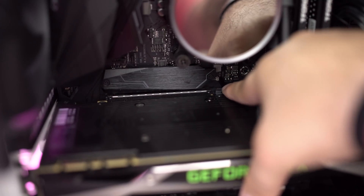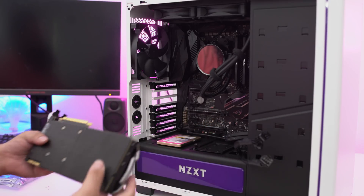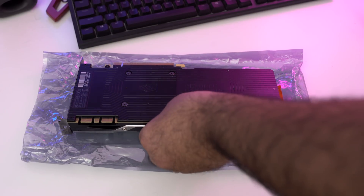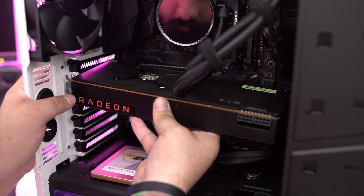Sometimes these locking mechanisms are very tricky to use, so be very careful. Try not to use any screwdrivers with a metal tip in there; if you can get a screwdriver with a rubber tip, it'll be a lot easier. Sometimes you can hit this little button and pull the video card very easily — other times it's kind of a pain, depending on what motherboard you're using. Remove your video card gently out of the system, set it in a static bag where it won't get any electricity on it. Then ground yourself out again and gently place the new video card inside your system.